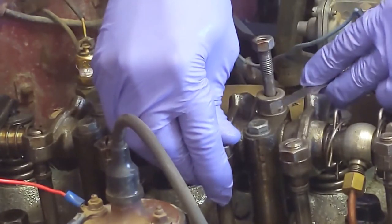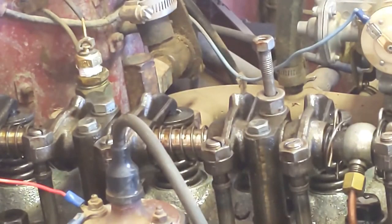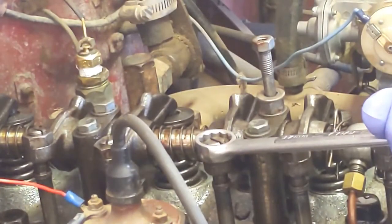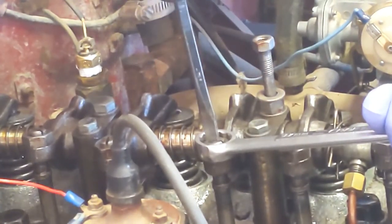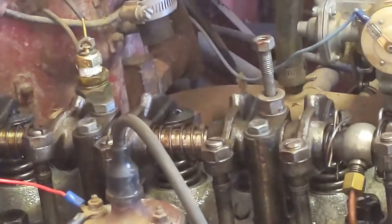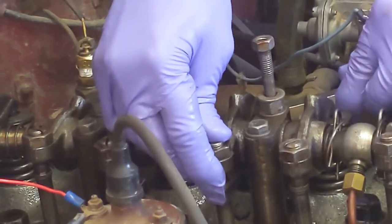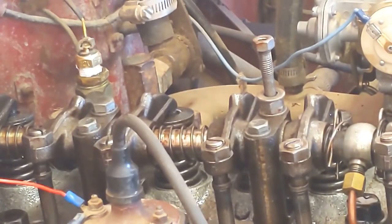Let's check this one — this one's too tight. This is the exhaust valve. It needs to be shorter. Give that a go — yeah, that's pretty good. I'm kind of wondering if those were backwards. That might explain why the compression was low on number four. We're going to find out in a minute here.